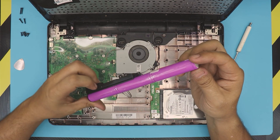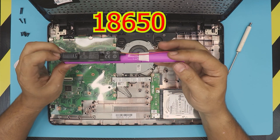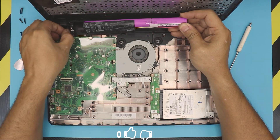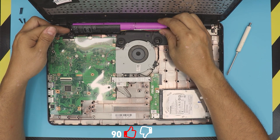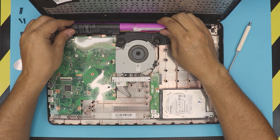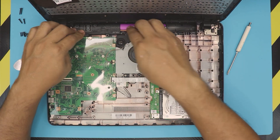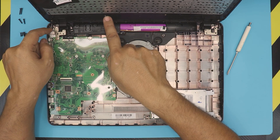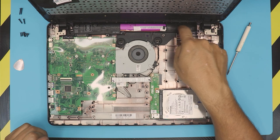There's a three-cell battery here — these are 18650 batteries. I'll put the link in the description. Once you get the new one in, twist it around, move the flex cable for the screen to one side, put it down facing down, and scoop it in. Then rotate while pushing it down and place it right there. There's no screw holding the front — the screws on the back go through and hold it from there, so pretty much only one screw holds the battery.